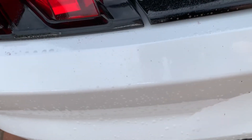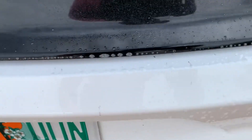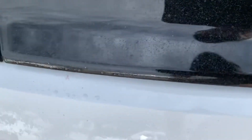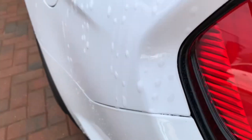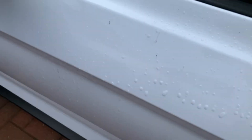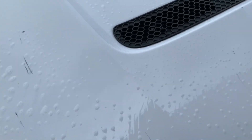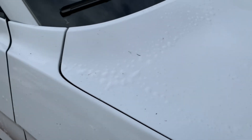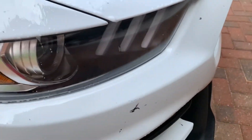At the beginning of the week it was really rainy and windy outside and I couldn't get the Iron X to really do its job because the wind was just blowing it dry before it could remove all the iron. You can kind of see the iron deposits on here — it's turning purple a little bit, so it's moving all that grime and stuff from the track. What this does is it safely removes all the contaminants from the paint without requiring any sort of clay treatment, which sometimes mars the paint. You can see how it's just eaten off right there, which is cool. We'll just let this set up for a bit and then wipe it down, set it up for a wash, get the rubber off, and on to the next step.